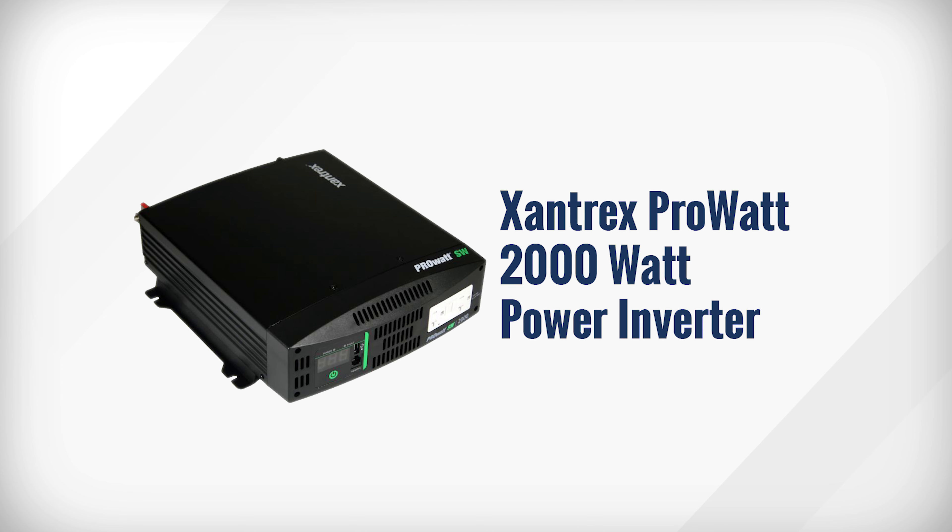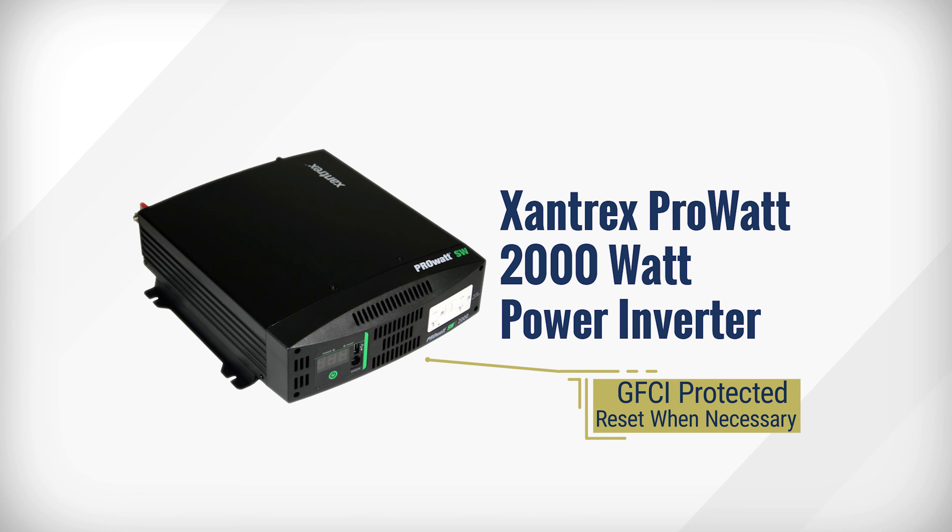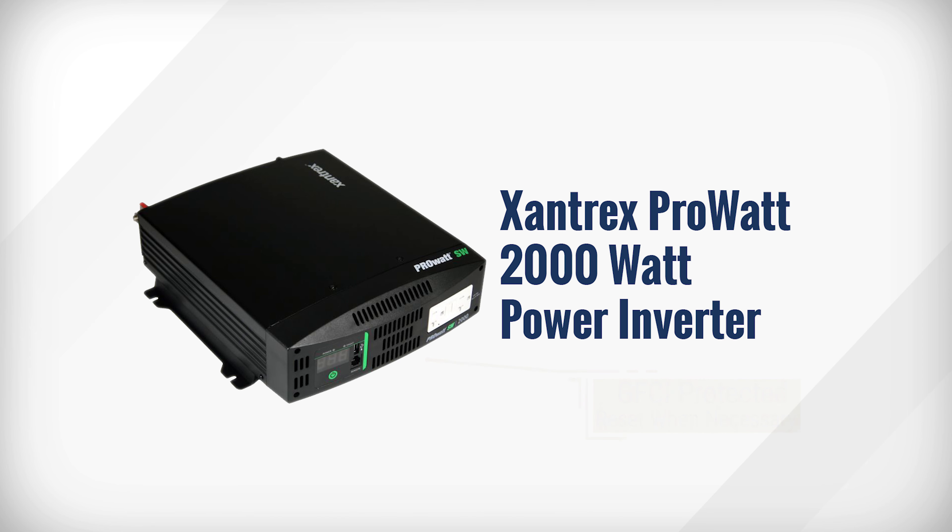If you have purchased our Xantrex inverter option, it will also allow you to use the 120-volt outlets on your travel trailer from your 12-volt battery system, and it will be pre-installed at the factory located under the street side access panel below the seat cushions or bedding. The Xantrex ProWatt SW2000 inverter provides a true sine wave AC output of 1800 continuous watts and is capable of running your microwave or other personal appliances off your 12-volt battery system.